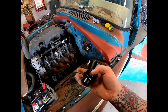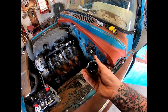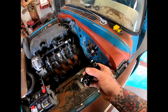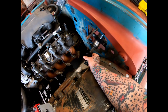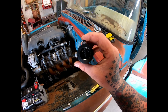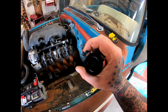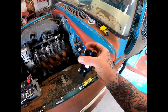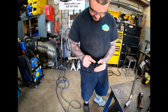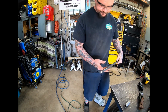So to connect our steering, I have a DD joint here, 1 inch on this side, 3/4 inch on this side, and the 1 inch will end up going on here. I'll probably end up drilling that one all the way through so it runs through the shaft. And then we'll use this one just as a set screw to create tension on it. So this joint's going to get us down to a 3/4 inch DD shaft. I have some of that right here.